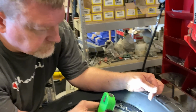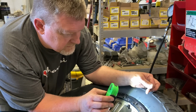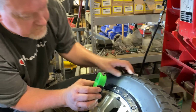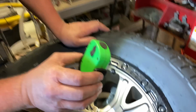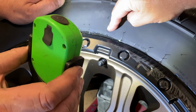We're discussing tire pressure at the moment. So we're putting 40 in, and I'm going to get this wrong one more time. It's because this is an LT tire, not a passenger tire. The treads are stiffer. We need more pressure in here. Hold that up. Right? Am I close? Yeah. All right. And then we're looking here. So maximum PSI is 80 for cold.